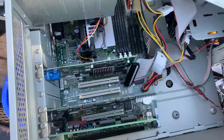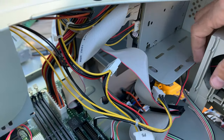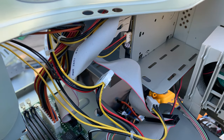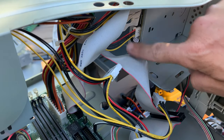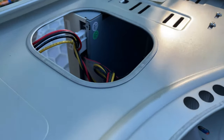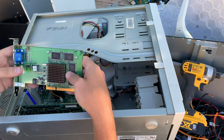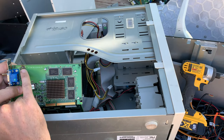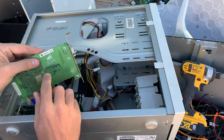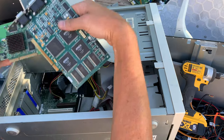Looking at the rest of this board, we've got a video card, and you can see right off that the hard drive bay is empty. The companies I do destruction for pull their drives. The optical drives fit up here — this is a floppy drive, and on the other side of the floppy there's a CD-ROM. Let's pull this card out — right off I can see something: this resistor blew out, that is heat damage. This card also says it's from 1999; it's a 3DFX card. This style is an AGP, so you don't see this style anymore.